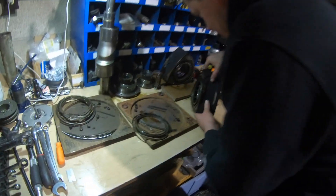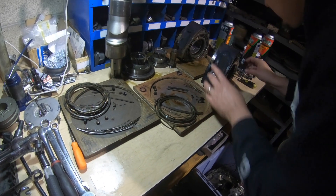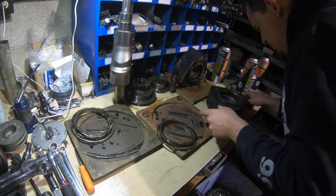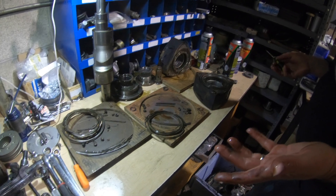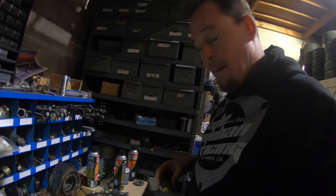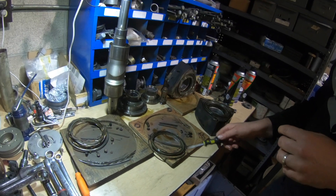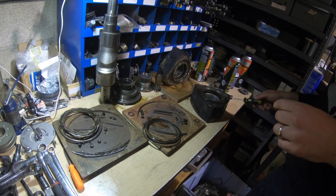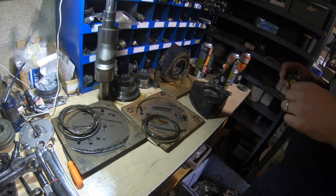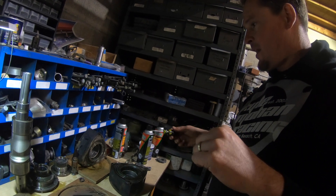Kyle was going through the oil control rings, scraper rings, and all the seals making sure everything looks good. We found out that the rotors were put in backwards by somebody — and that's probably not helping things out. I'm glad we discovered that. That might have caused a little bit of that weird wear we saw. Running the scraper rings backwards might not be a great idea — you're probably just sacrificing a little bit of power and longevity. We're going to get those in right. This was a balanced motor, so that will probably help out with the balance as well.